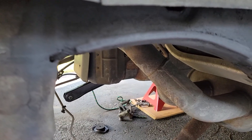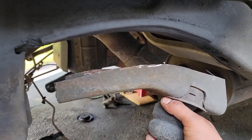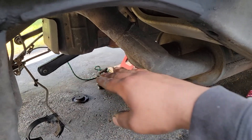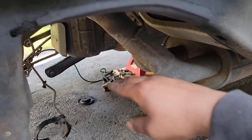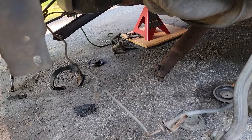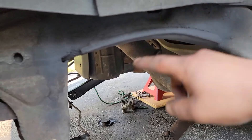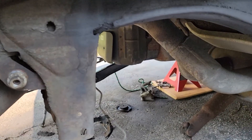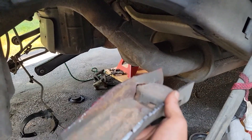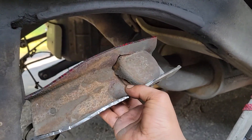This piece normally sits on here like that — you can see it's welded on. Essentially what you have to do is cut it off in order for the axle to have a little more travel room. The axle will be sitting about here, and when you put some weight in the truck it'll go up and down. I already did this side. You cut the outside lip here.